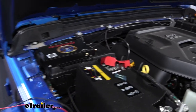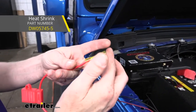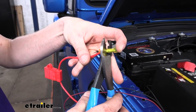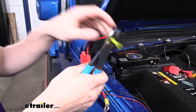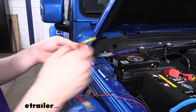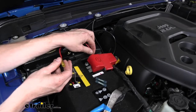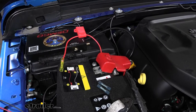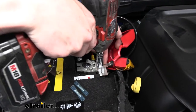On the other side of our fuse harness we're placing a butt connector — use heat shrink butt connectors rather than the regular ones from the kit, because these exterior connections are exposed to moisture and humidity. You want them sealed up to prevent corrosion. You can buy heat shrink butt connectors here at eTrailer. We'll go ahead and hook the ring terminal side to the battery, using a 12mm socket to remove the nut.